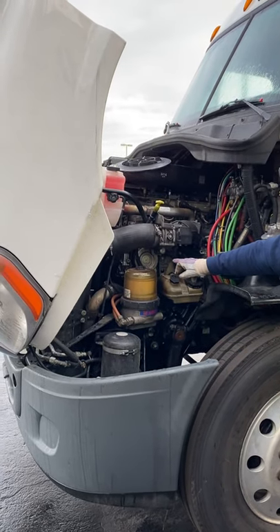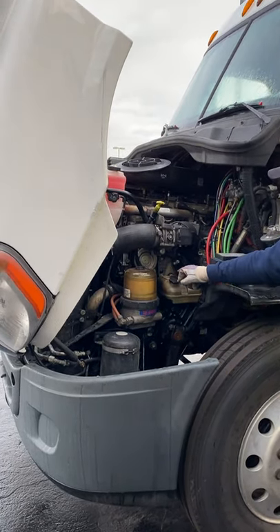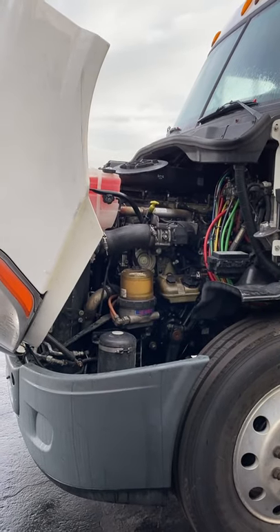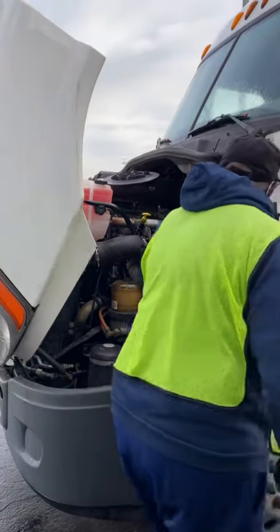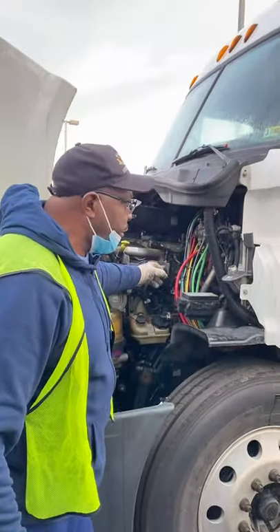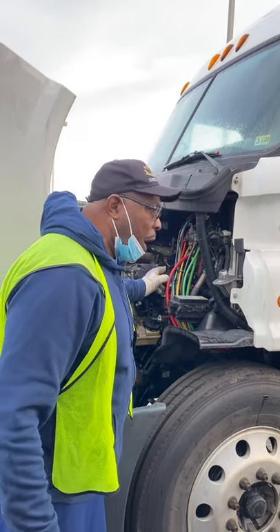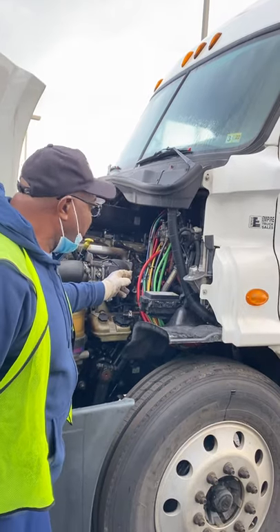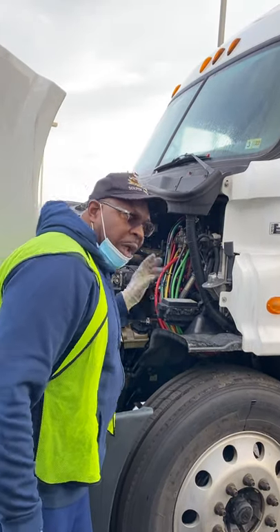My water pump — it's not cracked or broken, not missing nuts, bolts, or screws. It is belt-driven, and I see no leaks. Behind these colored lines is my air compressor, located in that vicinity. It's not cracked, bent, or broken, not missing nuts, bolts, or screws. It is gear-driven, and I hear no leaks.